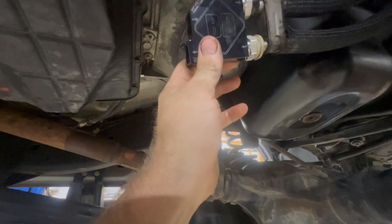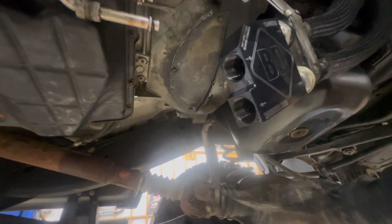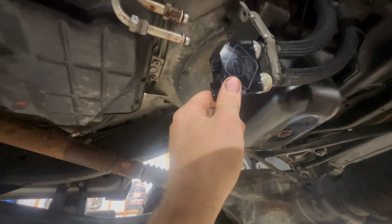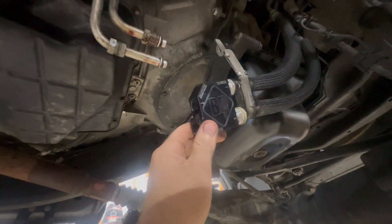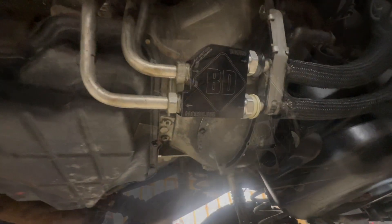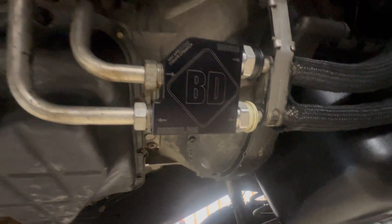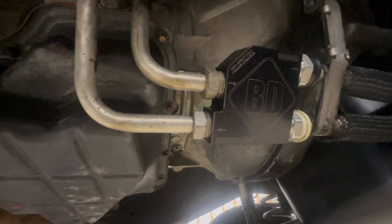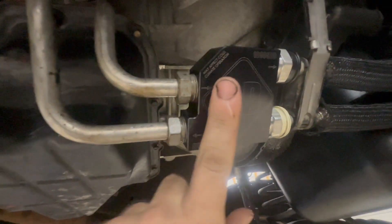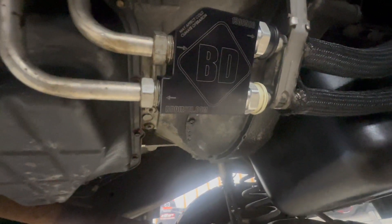Slide your plastic collars back on and put this up in place. We've got our new Viton o-rings on there and lubed up with transmission oil — put those in and tighten them up, put the bracket back on. Now you know for sure that all your transmission fluid is going to be flowing through the cooler and getting cooled, and you're never going to have a bypass valve getting stuck. There are torque specs in their directions — follow them because this is aluminum, and you don't want to start stripping out aluminum threads.